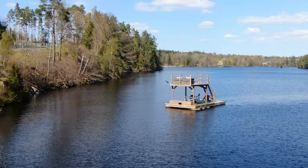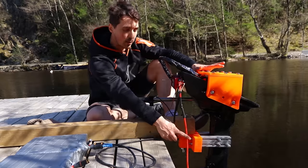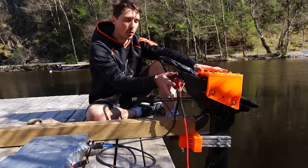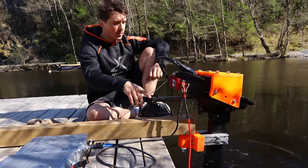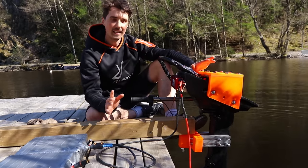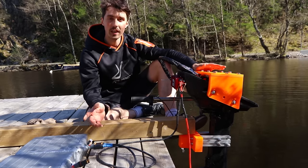The Achilles heel of this setup — the reason I couldn't go more than 40% throttle — was this plastic part here. I thought it was going to break for sure, and it's just got to be metal. We also need water cooling for the speed controller. Everything else worked pretty well and the steering was okay, but we've got to redo a couple of things. That will be in part two, where we also start building the boat. This is the end of part one — I hope you enjoyed it and I'll see you in part two.